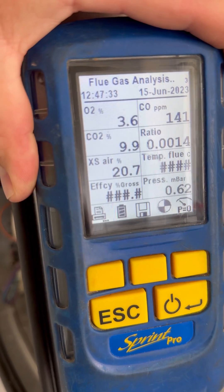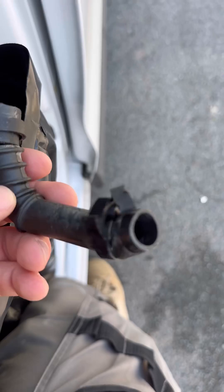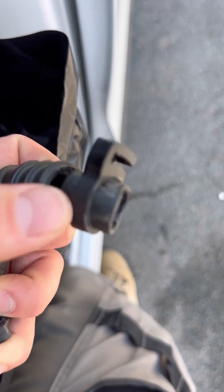Checking max — 9.9, that's better. When I did a poll on this, most people jumped straight to replacing the gas valve, so hopefully this will help you out. Quite often it's just a gas tube. Happy days.